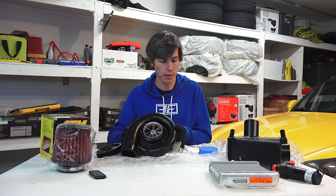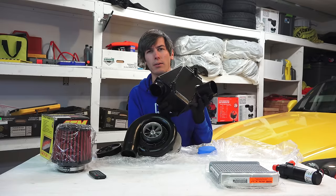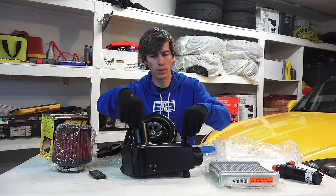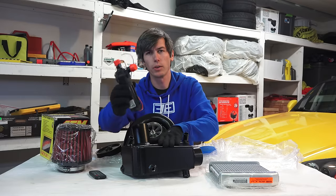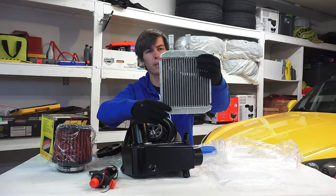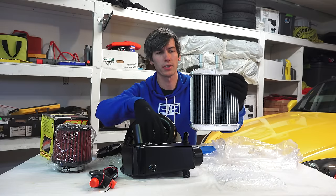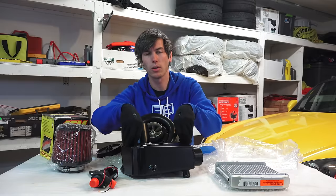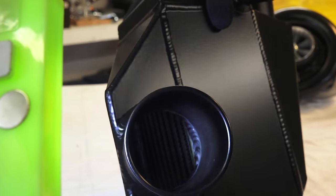The air can either go through an intercooler or directly to the engine. With this particular kit it goes through an air-to-water intercooler. You can see these two little hoses where coolant comes in one end and out the other. This electric water pump flows coolant through — it'll be hot from passing through the intercooler — to the front of the vehicle where air passes through to cool it, then it returns back to cool the intake air before it enters the intake manifold.